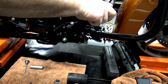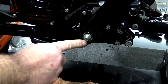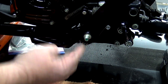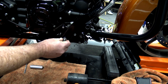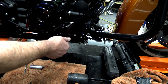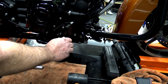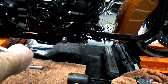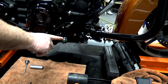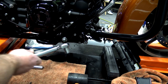Make sure everything works correctly — this is pushed all the way on. Come down here to the base; you've got your O-ring that's going to set in there, just like that. Washer and nut. I wasn't too worried about blacking out this nut or the washer because once you get your floorboard on here, you're not going to see this. It's a nylock nut, so go ahead and run that down until it touches, and then torque it down. That's the brake pedal shaft lock nut and it's 15 to 20 foot pounds — it doesn't take a whole lot on that one.